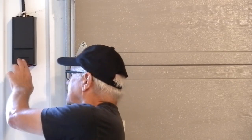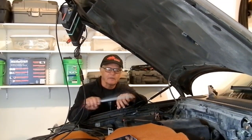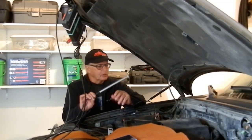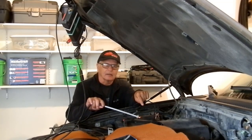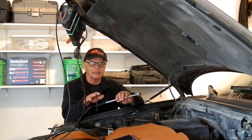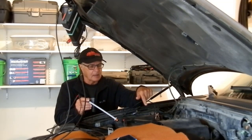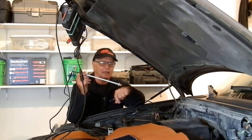Before I take you to the build of this DIY COP probe, let's bring in the guinea pig and we're going to test it out. You guys are familiar with my 2002 F-150 4.6 liter V8. Here's the newly built COP probe. The ground alligator clip is on the negative terminal of the battery. It's pretty tight and the fuel rail even runs over top of the coils partly, which says a lot for a compact probe design.